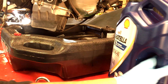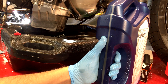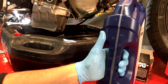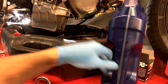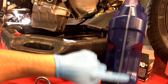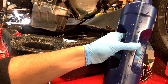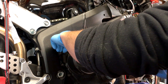Now we're going to add the oil. I've got my Rotella T6 here. You can use Mobil 1 4T racing oil — I used to use that, but it's 10 bucks a quart, so you're looking at $30 versus $20. If the extra cost is worth it to you, go for it — to me this is perfectly good stuff. This is one gallon, which has four quarts, and this engine takes three quarts. Go right to the three-quart mark, and remember this side is liters and this side is quarts. Now go ahead and take off your oil filler cap — it should just be hand-tightened on.